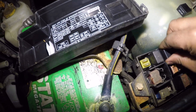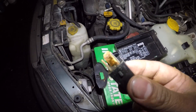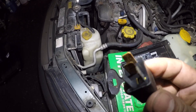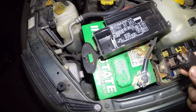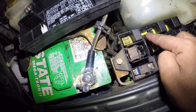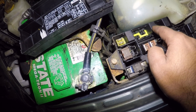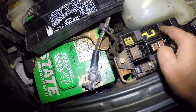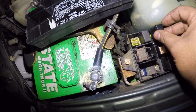All you do is you take it and you yank it right off. It's a four-pin relay right there. What you can do is take this relay right here and swap it over there just to test it — this is a relay for the sub fan. Make sure you put it back if your AC does work, but put in a new relay.